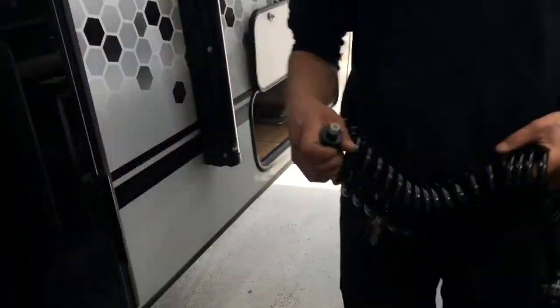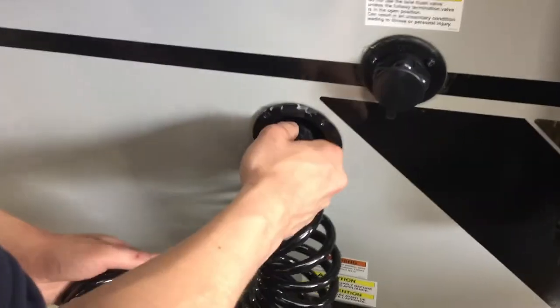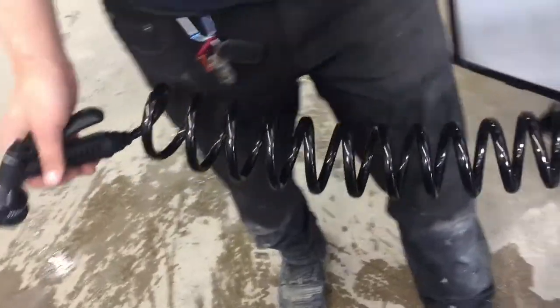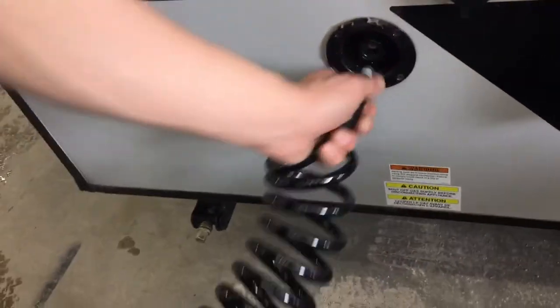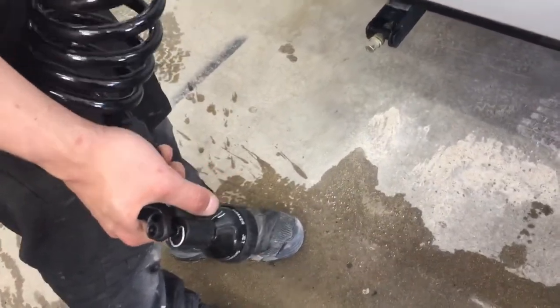This right here is a little spray port. Your hose has two little ears on the adapter — press those into place, give it a slight eighth-turn to lock it in, and you've got cold water through it. It is just cold water; it does not hook into the hot water system. Once you're done, extend it out to make sure any remaining water kicks out, then put it back away.